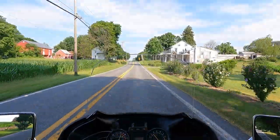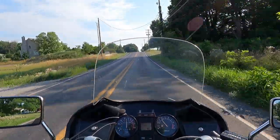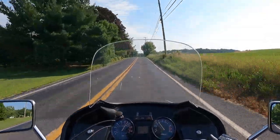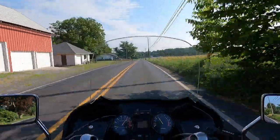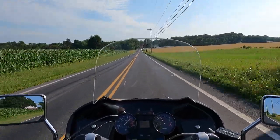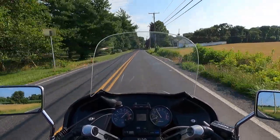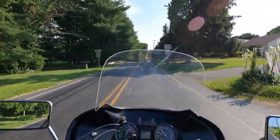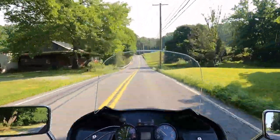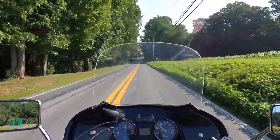The seat on this bike is not quite as comfortable as the seat on the Suzuki. This bike has a four-into-two exhaust — it's custom exhaust that was on when I bought the bike. It sounds nice with a little bit of an aggressive tone, but it doesn't have the sweet tone of a four-into-one pipe. Doing 60, it's revving about 4,000 RPM and the exhaust is not obnoxious, even behind this fairing. That can be a problem on some exhausts and bikes with full fairings — they tend to trap sound back in with the rider — so I'm thankful this one isn't obnoxious.